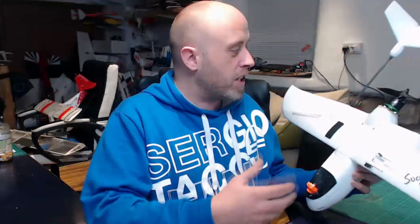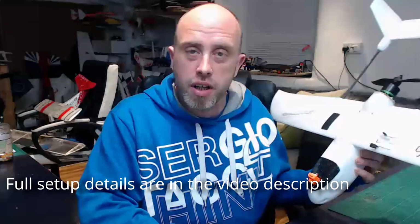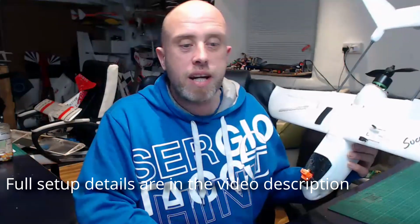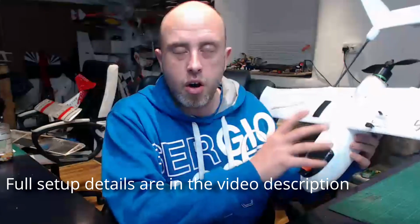Now, I think I'm the only person on the planet crazy enough to put that much copper on the back of a Micro SkyHunter. Remember that these models are only meant to be powered by quad motors, 2204 or 2205 motors. But this one is being powered by a Cobra 2814 10-turn 1700 kV motor, and she is running on 4S.